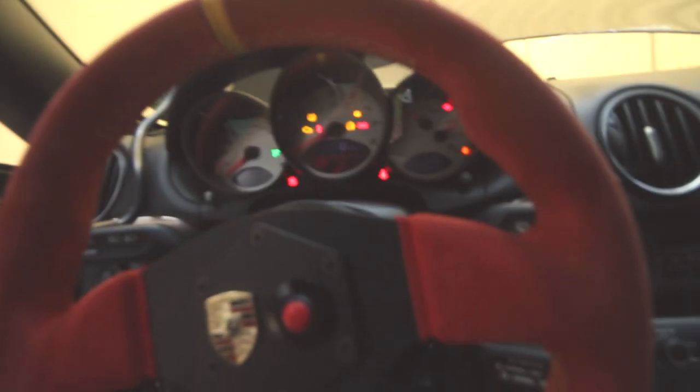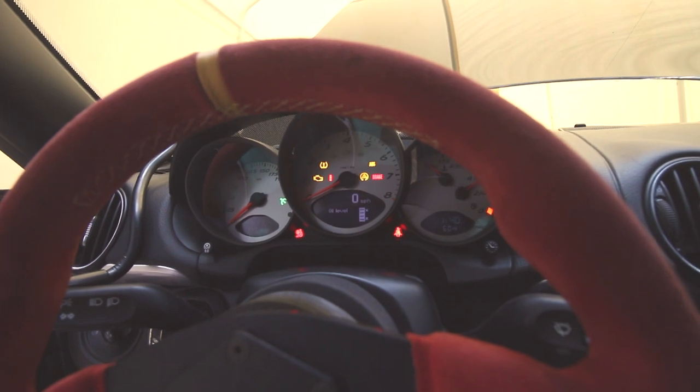That is complete — just completed the oil change on this car. I'm going to get everything cleaned up. The car is not perfectly level, just trying to check the level. That is how you change the oil on a 987S — it's a point-one, not the point-two; I don't believe the point-two is much different. You need the 74.2 millimeter oil filter wrench as well as the eight millimeter hex tool — just that little socket. You need your crush washers, your filter — the filter should come with the o-ring.